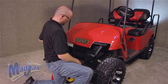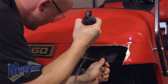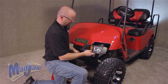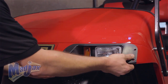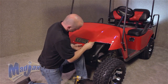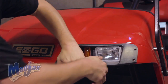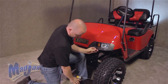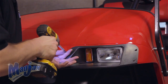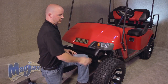Be sure to keep your template — we're going to use this on the other side of the golf cart. We're also going to take our cutting tool and remove the trim so that our light fits easier. Before we trim up any more, we're going to test our light and make sure it fits. It fits perfect; we don't need to take any more off. Once we have our light drilled out, we're going to take a little bit of sandpaper and clean up our cut. Place our headlight in and, using the screws provided in your kit, attach our front headlight. We'll leave the harness hanging and attach that in a minute. We're going to repeat this whole process on the passenger side of the cart.